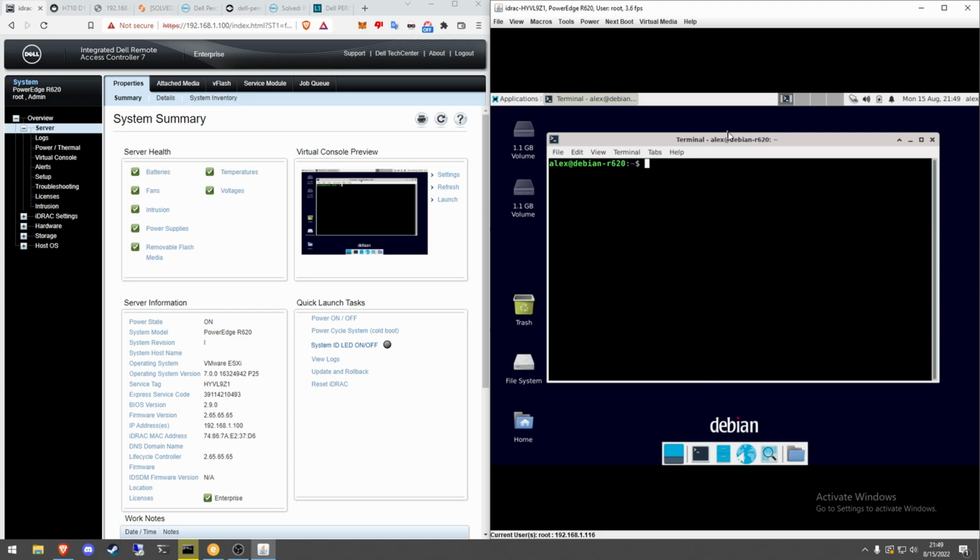My only idea is that the certain SAS drive I'm using is not supported. Like, either the capacity or the speed is not supported by the controller. I have no idea why. I don't know if there's something wrong with the controller, something wrong with the hard drive, but I don't have any other SAS drives to test, so I'd have to buy another one, which I'm not willing to do right now to test it.